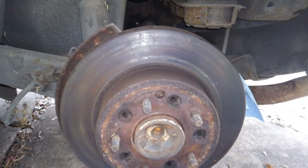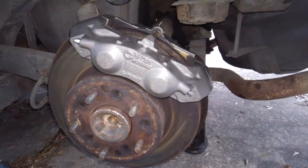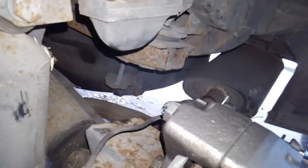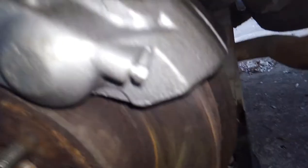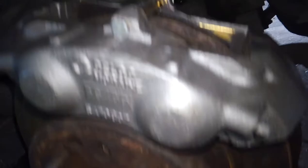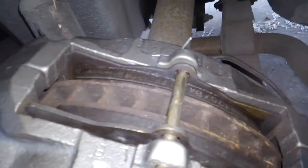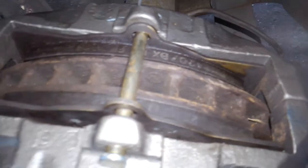Give me a few minutes — I'm going to put the new caliper on and bleed the system. We're back with the new brake caliper installed, with bleeder screws to the front and up so fluid bubbles travel toward the highest point. I cleaned up my brake pads and put those back in, though I don't recommend that when you have fluid contamination — it can cause other problems. But I'll probably change these out in the next few weeks; I just want to get it back together for right now. These are extremely simple to pull the brake pads out of.